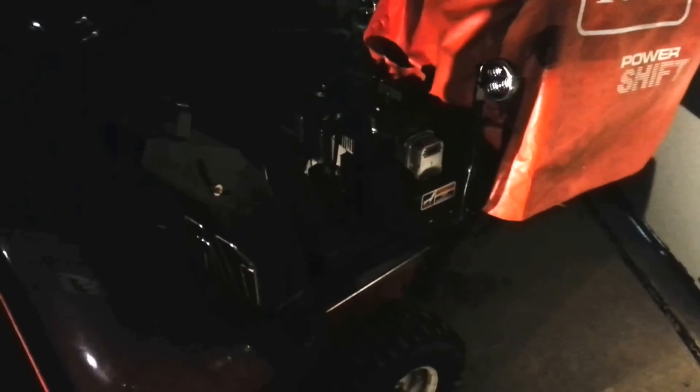So I now have two LED headlights. However, this is a different type of video than what you're typically going to find on YouTube or anywhere else, because I actually wired up these headlights using a bridge rectifier. Since the voltage coming out of the headlight circuit is AC voltage on most snowblowers — I don't know of any that are actually DC unless they have a battery.